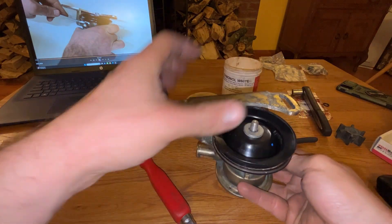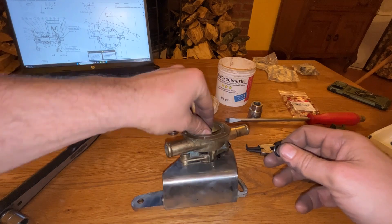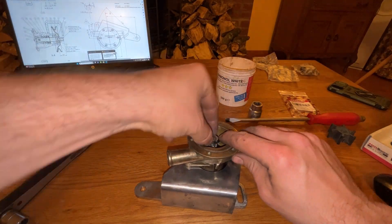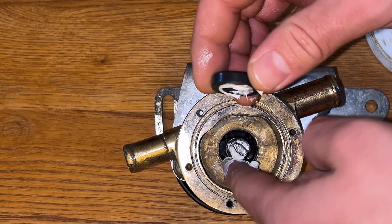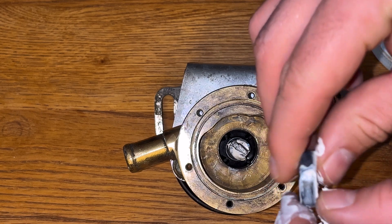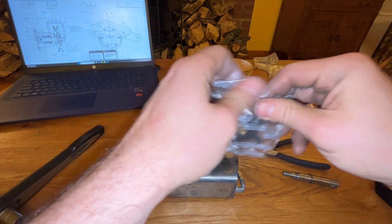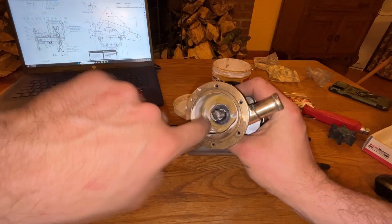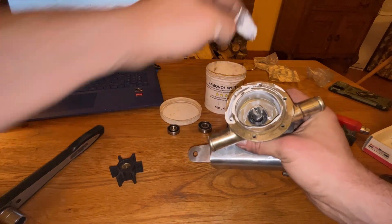Pop on another washer, then put the top locking nut on. Next up is a bit of grease on the drive shaft, then slip on the o-ring. Last is the water seal — put loads of marine grease on it; don't use petroleum-based grease or it will perish. The flat section of the lip seal needs to face downwards and the recess and spring should be facing you. The lip seal needs to be pushed in so the top is flush with the brass housing. Last of all is the water pump impeller — grease up the whole internal shaft area so there's no friction before the water is primed.